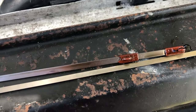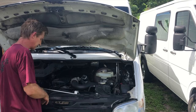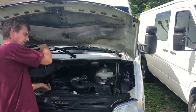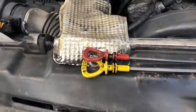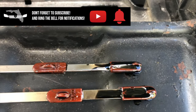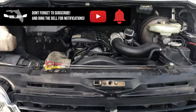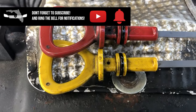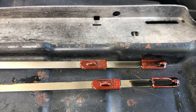This is a warm engine, so we've got the proper amount of oil in it. The yellow dipstick is made to check when the engine is cold. This van is not warmed up — I just started the engine for a little bit to circulate the oil, and now we're going to take its oil reading. So again, we're going to line up the dipsticks and follow it down — obviously it's reading the same depth. Since this is a cold engine, we want to be looking at the yellow dipstick, and that shows just where I like it.